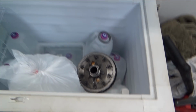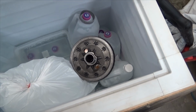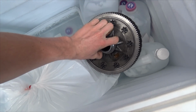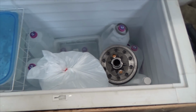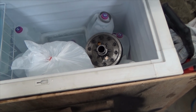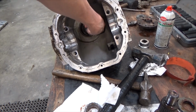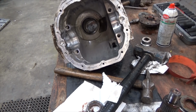And so let's take a look at the carrier assembly, which is just in here. It is cooling off because to get these bearings off, they're a real bitch, and to get them back on, they're also going to be a real bitch. But it's a 2-post puller from there, pulls it off, and the same on the other side. Even though it's easier, you can hit it. But anyways, my spider and everything in the middle there looks in great condition, and I have no worries or woes about the clutch pack. So I'm not even getting into that, I'm just fixing what I know needs to be fixed. Anyways, I will probably catch you later when we're back assembled a bit more here.